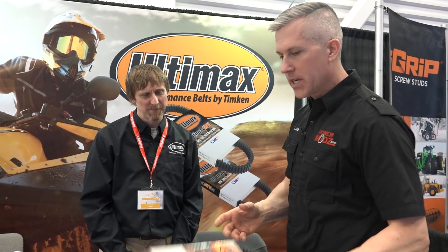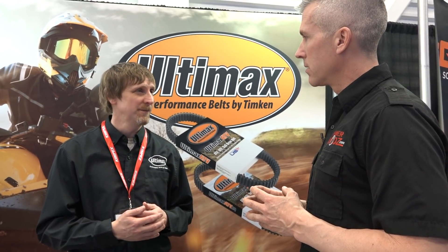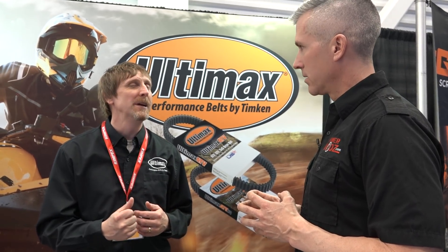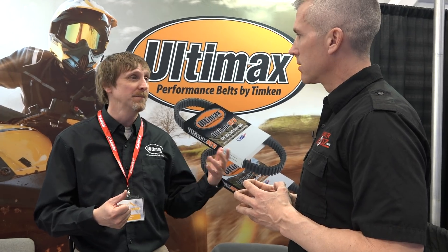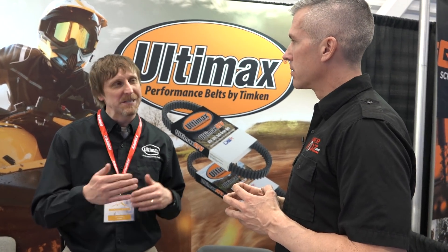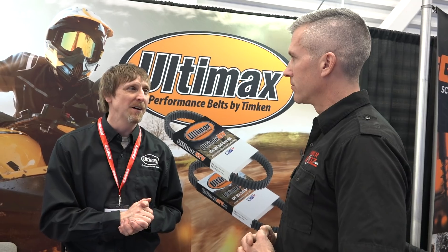Are you a salesperson with Ultimax? No, I'm the engineer for all of Ultimax. So you know what you're talking about. What's your best belt for a Polaris 800 Axys? It's the XS. The XS is a high-temperature compound, so it's a lot better for places where you're really putting the screws to it. The only downside is that it's more aggressive, so it might pull your RPM down if you're at elevation. When you first switch to XS from OE, it's a good idea to watch your RPM — you may need to take a couple of grams out — but it's a great belt.